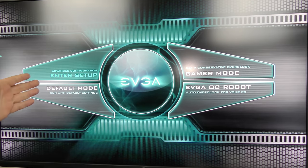When you come to the Windows Setup screen asking where you want to install Windows, if you have other drives there's going to be a bunch listed here. I always recommend installing with no other drives plugged in, but if you have to — notice Drive 1 has four different partitions, and Drive 0 shows a 930 GB or one terabyte drive. We want to install onto the 500 GB drive, so select the unallocated space and click Next. If you already had a drive with Windows installed, you'll be given a dual-boot option — I like one OS, so I'll select Volume 2.